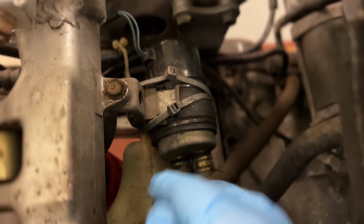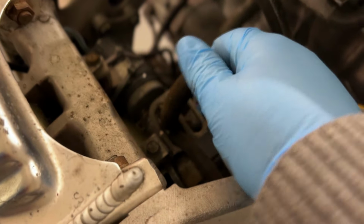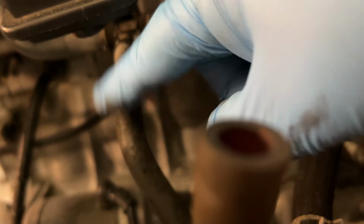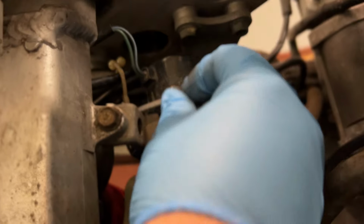So this is its fuel pump. This is where it gets fed from the tank into a filter. So from the tank, by gravity, into the filter, into the fuel pump, then off into the float bowls on the carbs. And what we have here is lots and lots and lots of mould. And that's seized. And I love these.